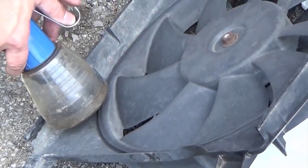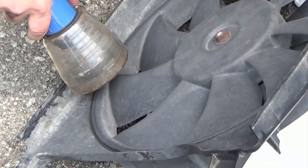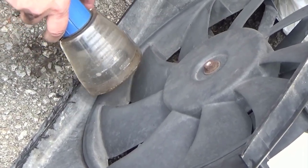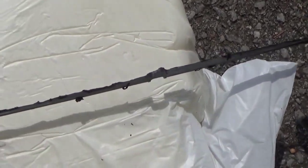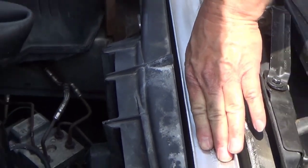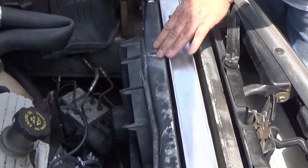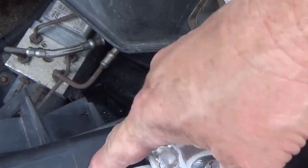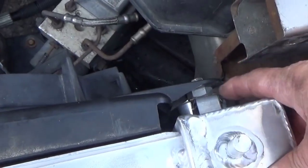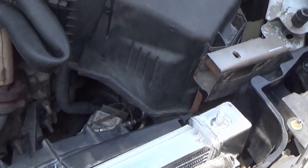What I'm cutting off is very minuscule so it's not going to hurt anything. The radiator could probably have been bought with the fans because AlloyWorks does sell radiators with fans included, so that's an option. We wanted to go ahead and use the factory setup. You can see how much was cut off — about a quarter of an inch — and that allowed the hooks to catch on the fan shroud. Because this is a three-core radiator rather than the single core we ordered, I had to put a nut as a spacer to keep the front fan shroud from bumping into the actual fins of the radiator. Of course you can also just cut it — either way it still pulls the air just fine.